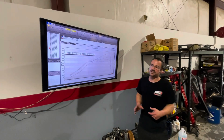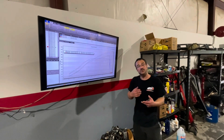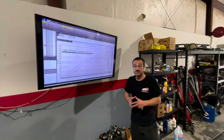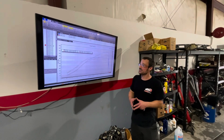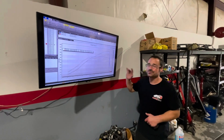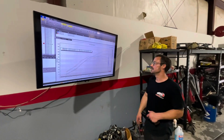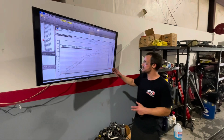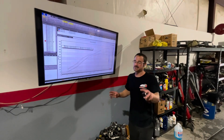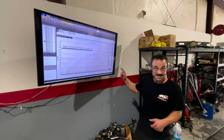The thing people don't realize — when you have that extra fuel from methanol, you have that extra oxygen, you have that extra drive to push the turbo a little harder, so you can make a couple more pounds of boost. But considering it's 95 degrees out, 31 pounds making 613 is absolutely amazing. Another testament — this car is just wild. We're going to see some videos soon enough of what this car does on the street, but this is going to be one nasty ride.